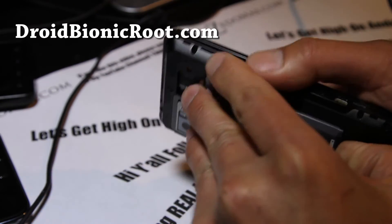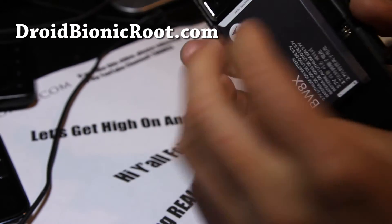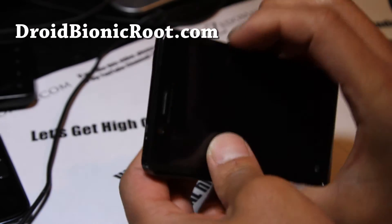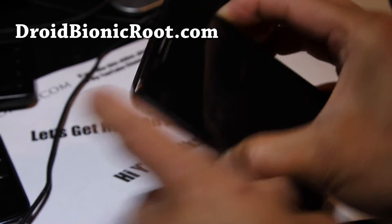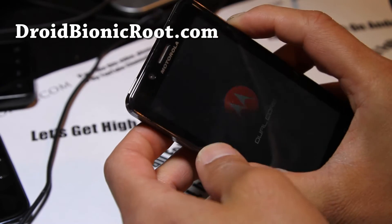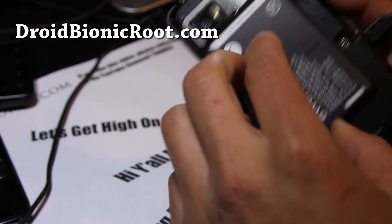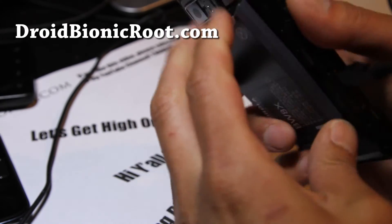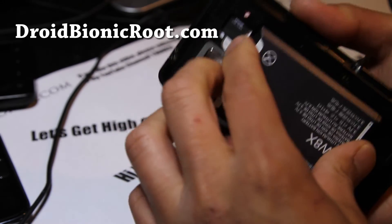So let me show it to you again. If this happens to you, just do this — very simple. Plug out the battery, plug it back in, hold down volume up, volume down, and plug in your power, and voila — you can get into all the menus that you need to. You can even get into recovery. I'm just going to let it charge; it will still charge that way too.